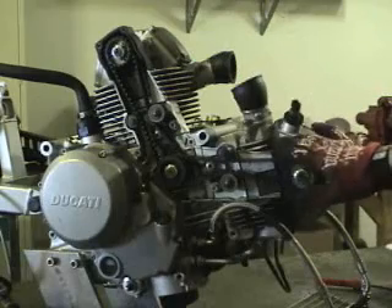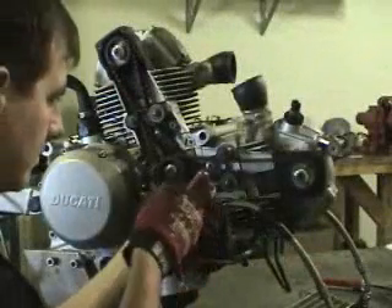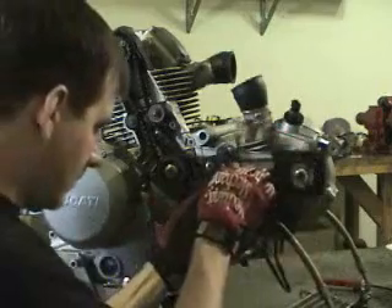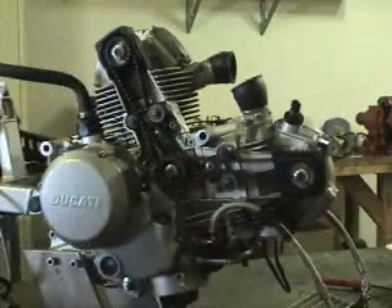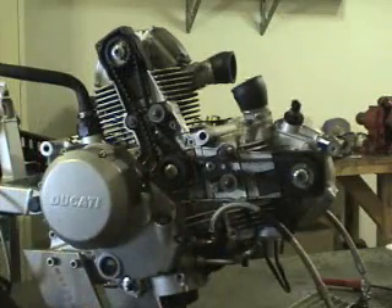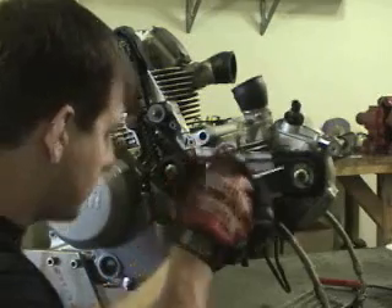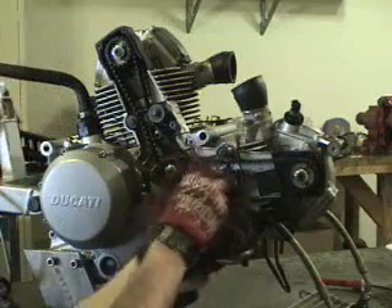With the dots lined up, the forward cylinder is at top dead center. We're going to set the belt tension now. You start by hand. I always visually check that when I pull down on the belt I can get it off the pulley. See if you can slide a 5mm Allen key across the idler pulley. Now we'll try to slide the 6mm key. It was quite difficult to slide the 6mm — impossible with one hand. That's perfect belt tension.